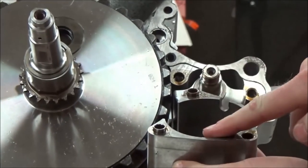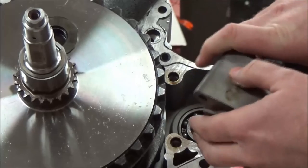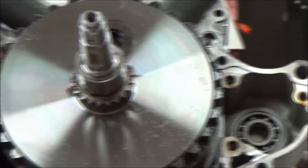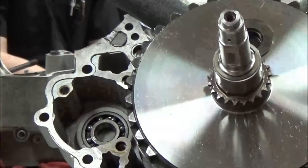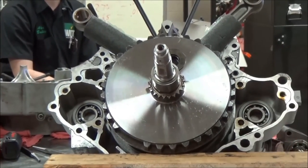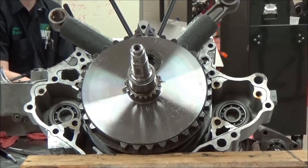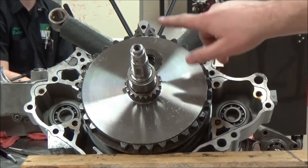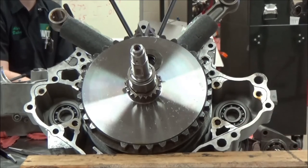From here you'll see this is just on dowel pins. Nothing too spectacular about that. Britt goes ahead and pops the other one out and wiggles it apart. Now you can see the difference — you can see our bearings in here, and I promised you this is pretty simple to do. We're definitely going to get our flywheel out of the way so we can clean all this old sealing off as we go back to assembly.